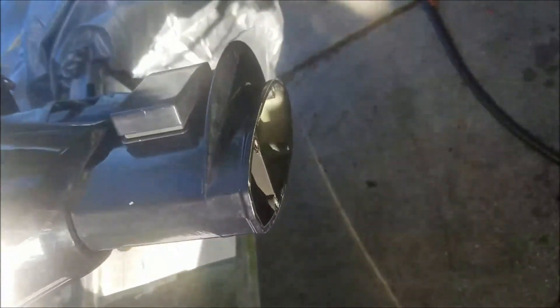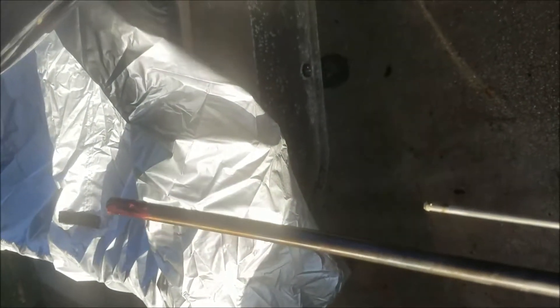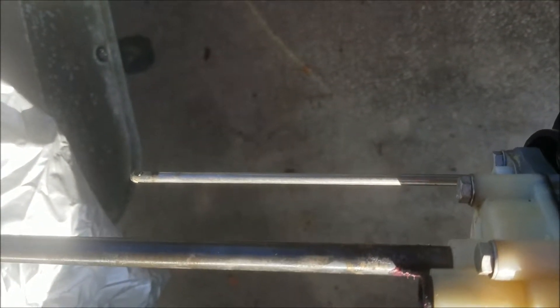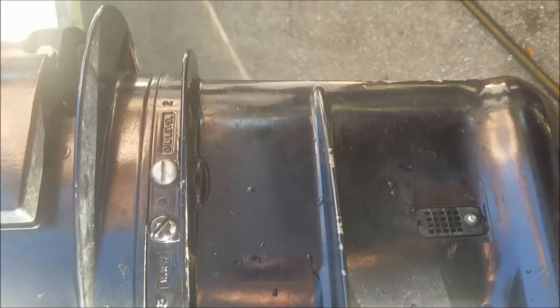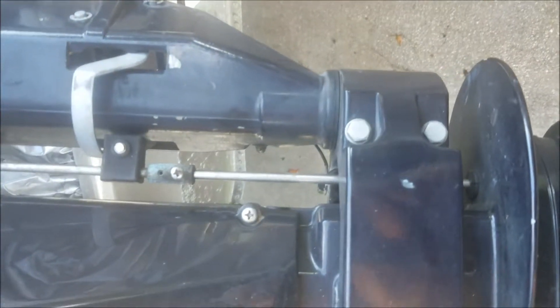Now I'm going to put the foot back on the motor. I'll need both hands so I'm turning this off and sliding it into place. Make sure you put a little grease on the end of the shaft and that the shift goes through the correct hole — you may have to wiggle it a little. I got the foot back on and I'm bolting it down with the four bolts, two on each side, with grease on the threads. Then I put the shifter pin — in our case a screw — back in place.